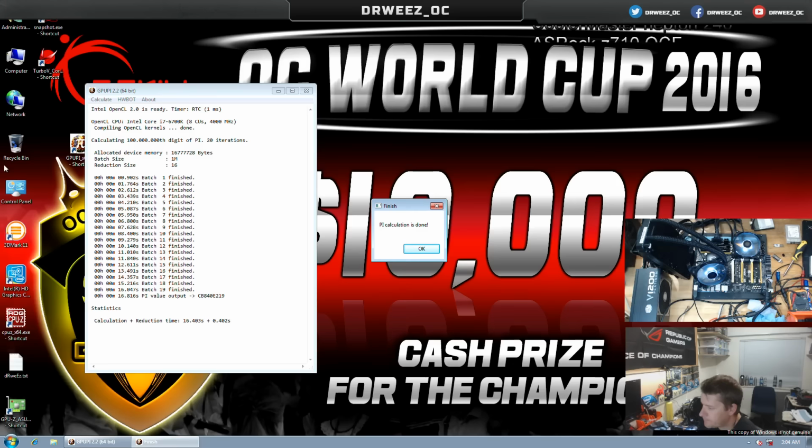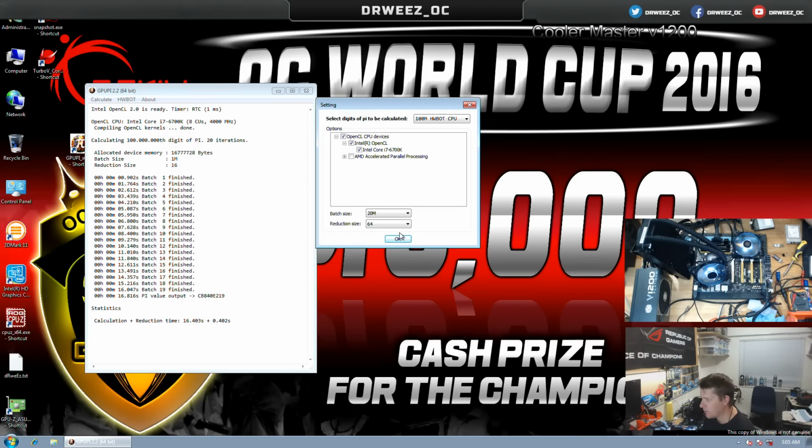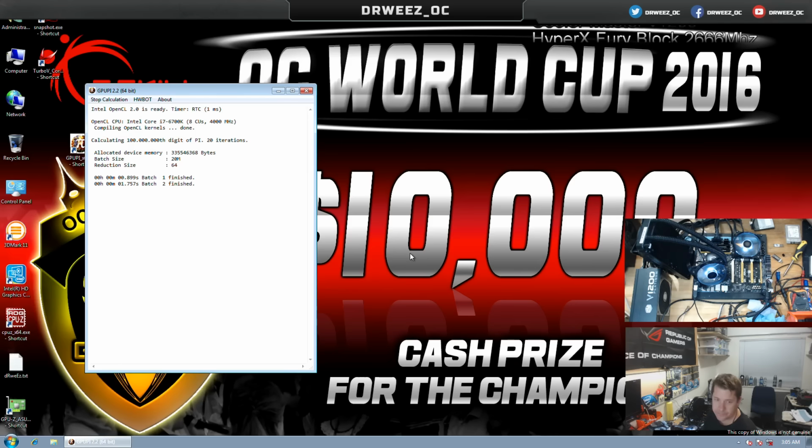Now for GPUPi, what am I going up against in the Rookie Rumble? Well, for 100M, which is what we ran, we're going up against 11 seconds, with 15 seconds being the second place. That one is also on an AMD, no, that's on a Core i7-5820 at 11 seconds. And if we have a look at what he was running, you can bring it up and see what batch size he was using. He was using batch size 20M and a reduction size of 64, and he got 11 seconds. So if I do the same for the batch size of 20M and a reduction of 64, we previously got 16.81, and let's see where we go now.